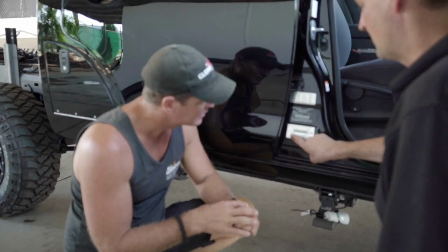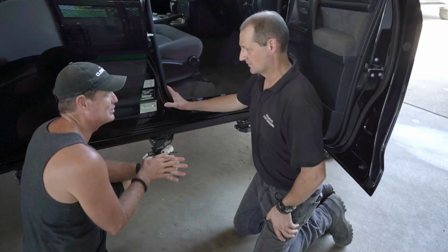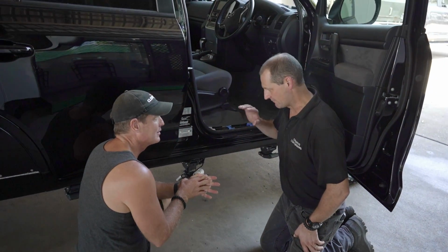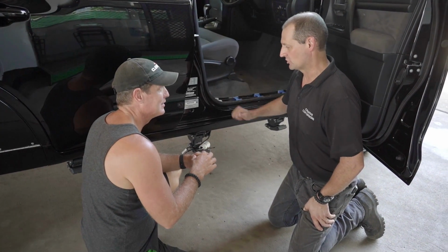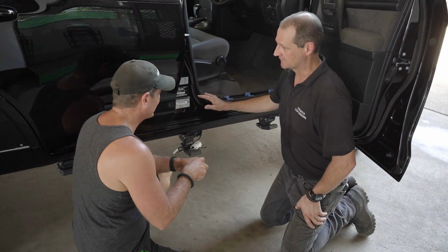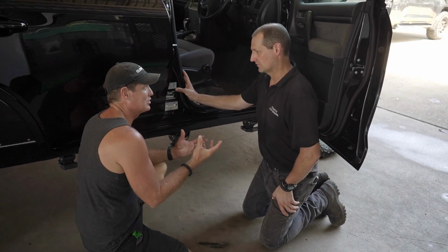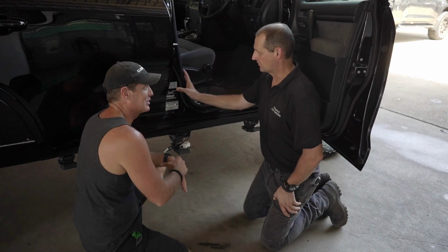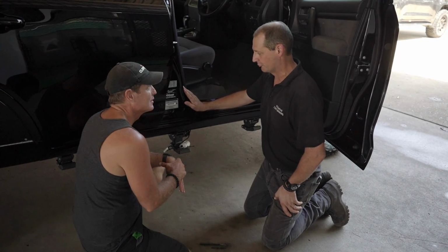And you have a GVM of 4.2. So this vehicle weighs 4.2? It can, so everything in it with the tow ball, with the ball weight, the whole lot. You can go up to 4.2 on that one. And then what's the total GVM that I can carry when I'm not towing? So when you're not towing, this one we've done a second upgrade to, and we've got to 4495 as well.